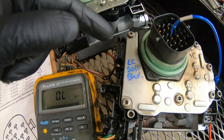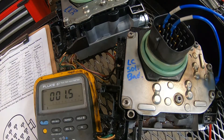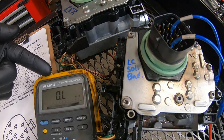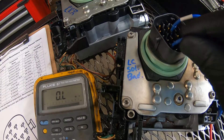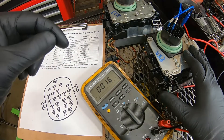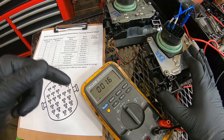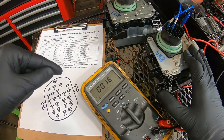I went ahead and swapped out the two solenoid packs so I can show you what's wrong with this one — it's a little bit different. On a known good solenoid, we're showing 1.5 ohms. The one that's bad on this pack is what we call the LC solenoid — that's terminal 17. When we hook up to it, we get no change — it's showing an open circuit. We'll verify by jumping over to terminal 19, where we get our 1.6 ohms. So we've got an internal open. Like with a lot of other things, this method isn't 100% foolproof — just because a solenoid ohms out fine doesn't mean it's operating properly. But it's another tool in your arsenal. It doesn't cost anything to download this form and do some resistance checking to see if you have a bad solenoid.